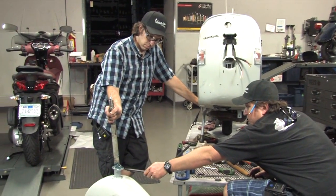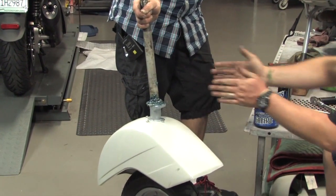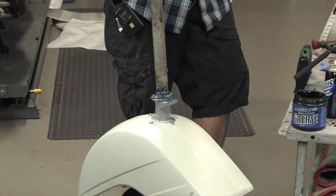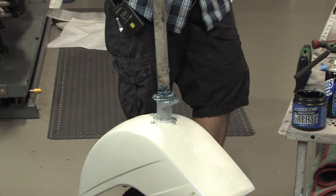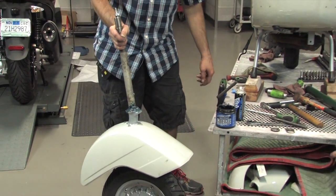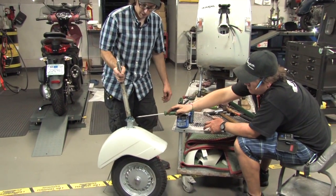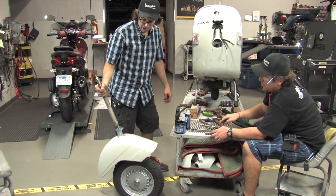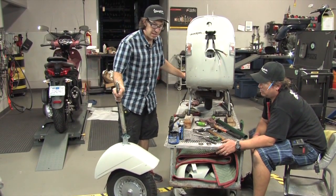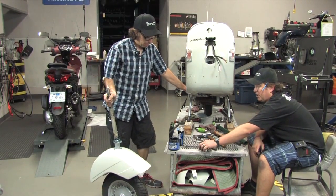This cast aluminum steering knuckle actually contacts the steering stops on each side. As the fender rotates, those knuckles contact the two stops, which limits handlebar travel. If the stops are too blown out, I'll go in before powder coating with a TIG welder and build up the corners — usually adding a lot more than needed — then dry fit it and grind out what I don't need.